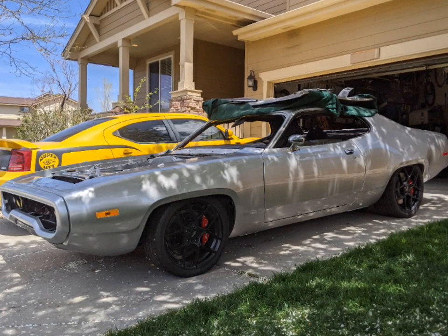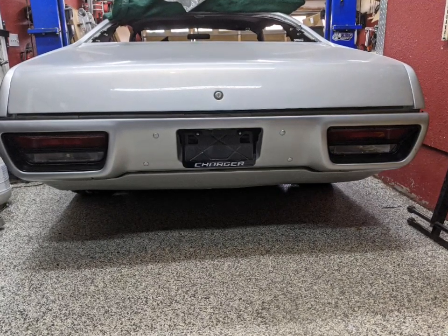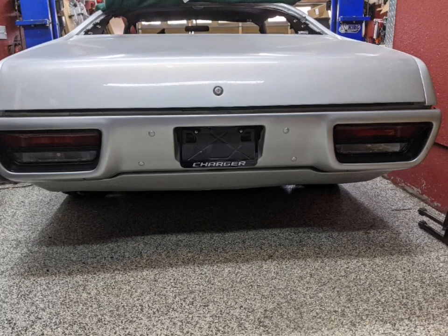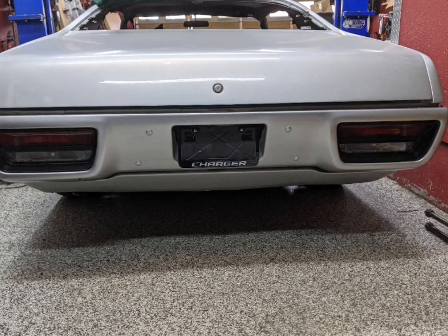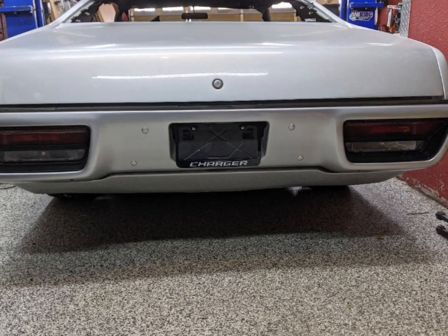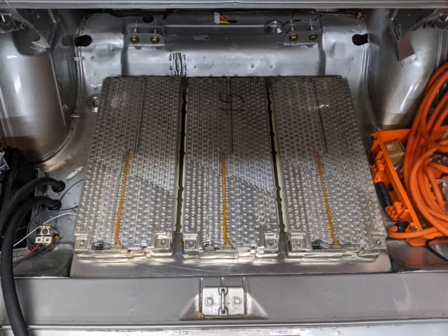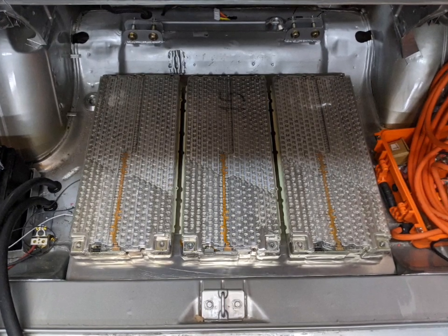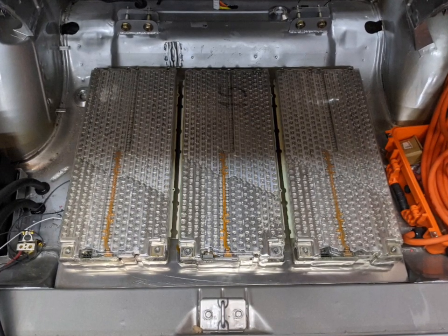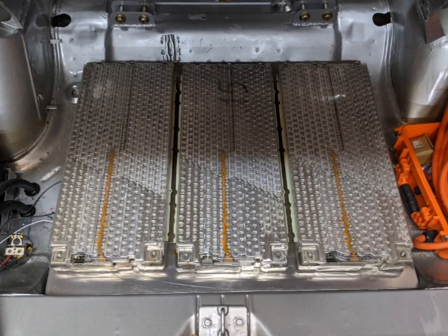Last time I built the front lower box, which was lowered into the front K-member and secured. Now I had to work on the rear battery box in the trunk and another one in the front on top. This rear box is a nice location because it fits deep in the trunk — it's a trunk that's split in the middle with a lower area below the deck lid, so I was able to utilize this space. I had to space it up a little bit to get the dimensions just right, so these are sitting on a 2½-inch square aluminum tube, and then I've got an aluminum sheet as the bottom of the box.